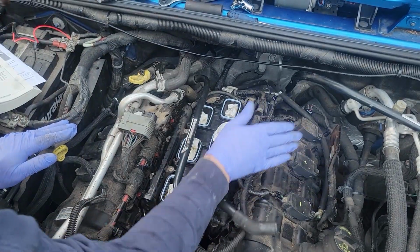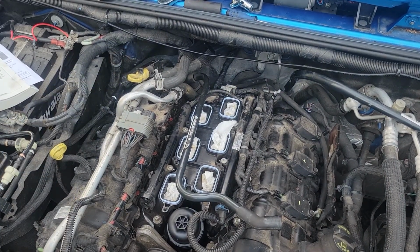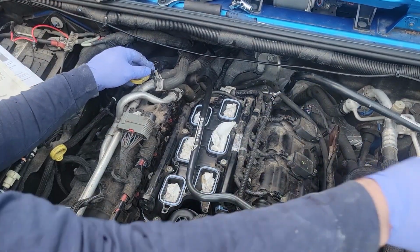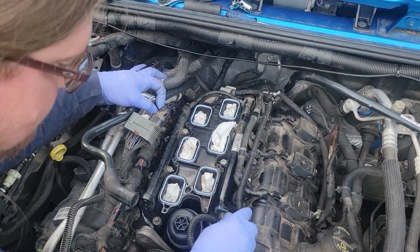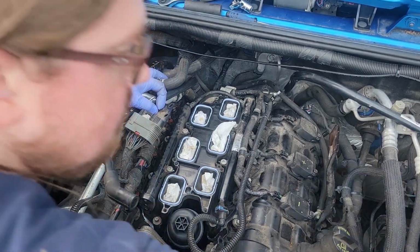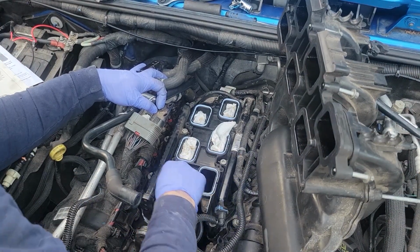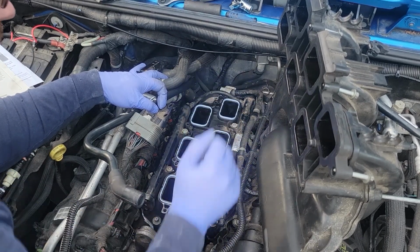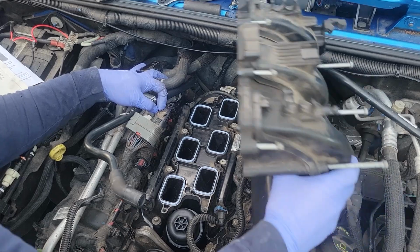Now there's a foam insert that goes right here, but I think this one is long gone. Now with that done, everything's connected. Double check my work. We're torqued. Everything's installed. Now we bring the upper intake back on over. Make sure nothing's missing. And now we pull these paper towels out first. Make sure your seal stays with the thing. Okay, now we just tip this back on over the way that it came out.